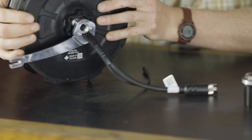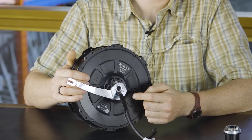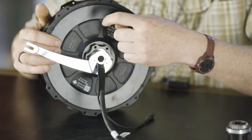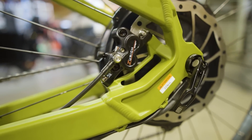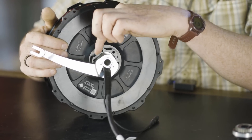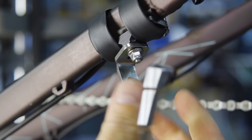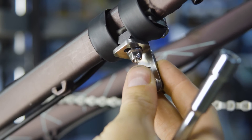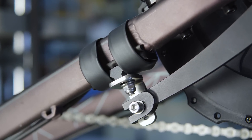It also has an integrated torque arm on the non-drive side of the wheel. We machined this torque arm to be as low profile as possible, just hugging the axle to have the least amount of interference risk with the disc caliper hardware that exists on a lot of bicycle frames — especially post-mounted disc brakes that tend to have collision considerations when you have too large of a torque arm on that side plate. This torque arm design conveniently attaches to the chainstay with a universal swivel mount that can accommodate almost any orientation, alignment, angle, and diameter of chainstay tubing.